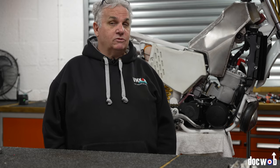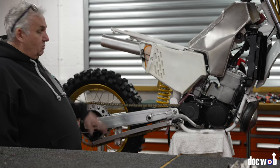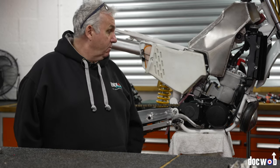We've got an issue with a shock on this one — it's not long enough. I don't know why we just put it back together. I'm guessing there may be a plating issue stopping the piston coming all the way to the bottom, so we'll investigate that. We do have another shock on the way, which we'll probably put on the '86 and use the bits from the '86 to make this one work better. At the moment it's too high, so we need to figure that out. But apart from that, we're getting there. Hopefully in the next couple of episodes I can get my ass into gear and actually do something with them.